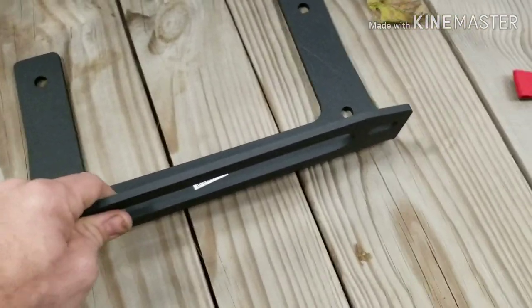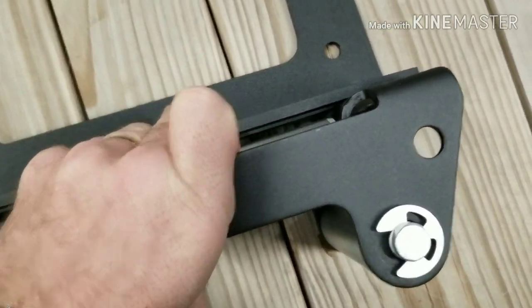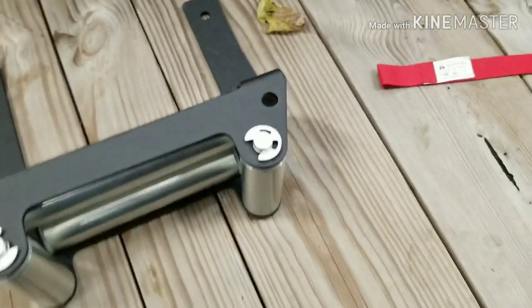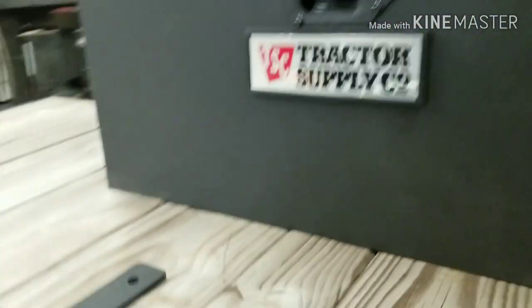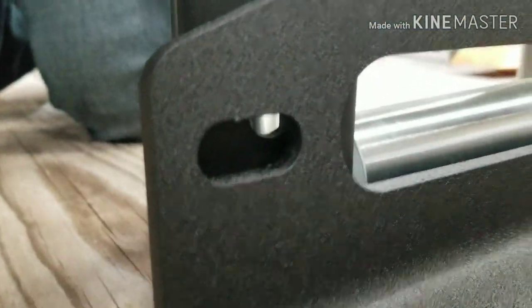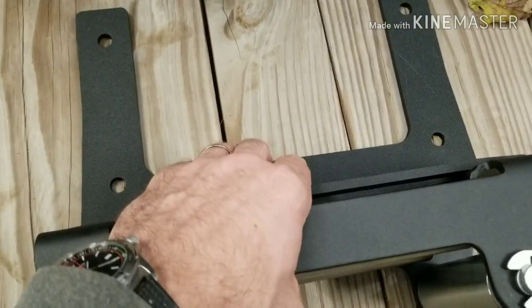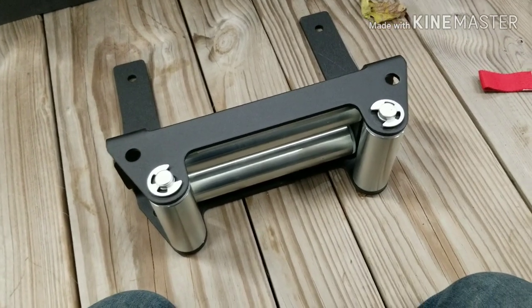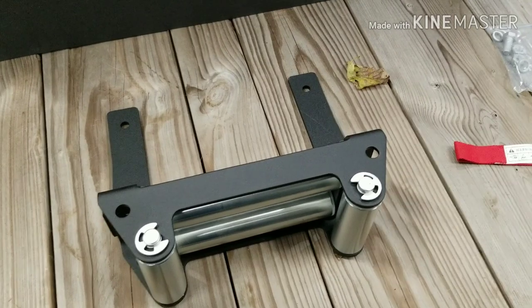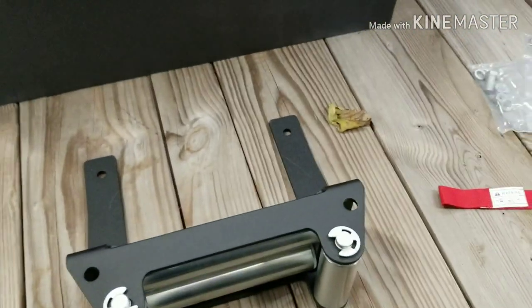Now with this fairlead over here mounted, let's see if I can do this so you can see it. If we mount the fairlead flush where it's sitting on the ground, there's a little bit of a gap in the side and the bolt holes don't quite line up. So we have to put a little bit of a spacer underneath here so that way it raises this up off the ground about a quarter of an inch so we can mount our fairlead and it'll sit decently. To accomplish that I'm just going to use some quarter-inch aluminum plate.